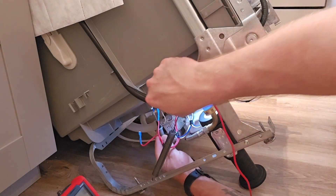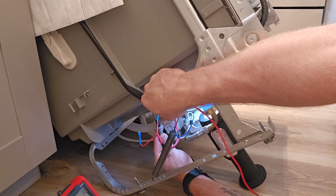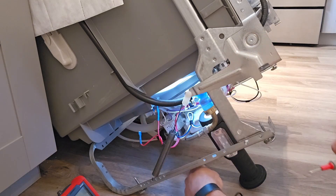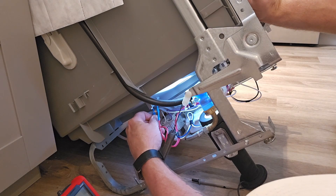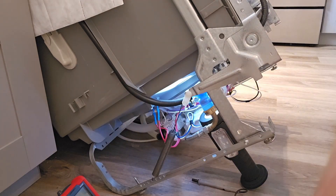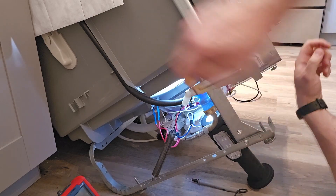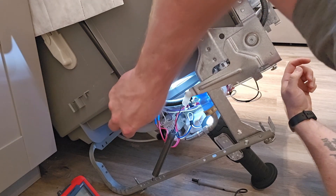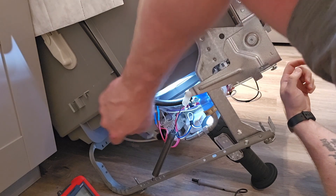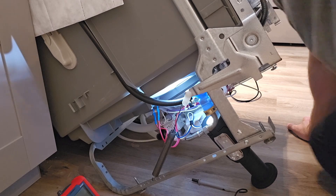Make sure you're getting a good connection. If you're going to leave one connector on, make sure you can get a good connection on the other. That is reading 0 ohms, so that means it's good. There's also a little reset pin on this thermostat — if you read it and it reads as bad, there's a little reset you can push in — but it's testing good, so let's move on to the next thing.